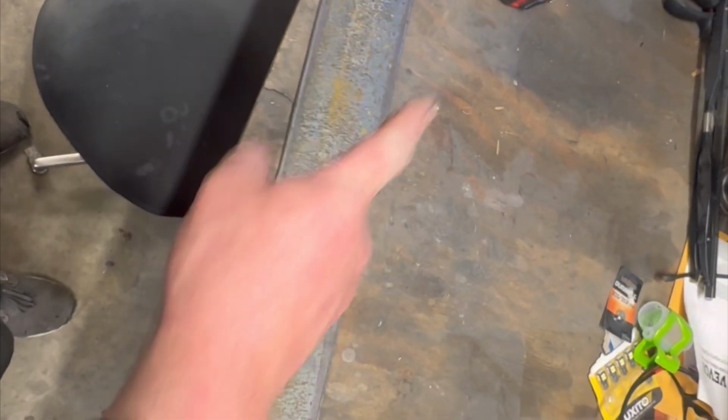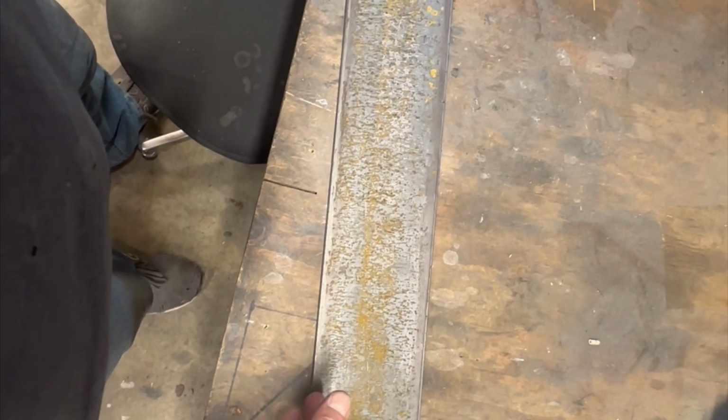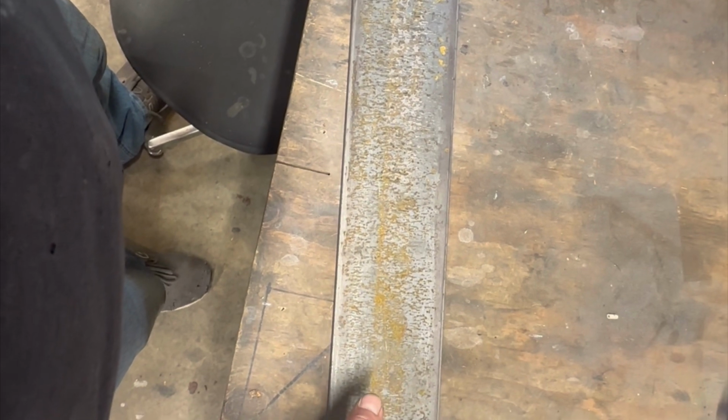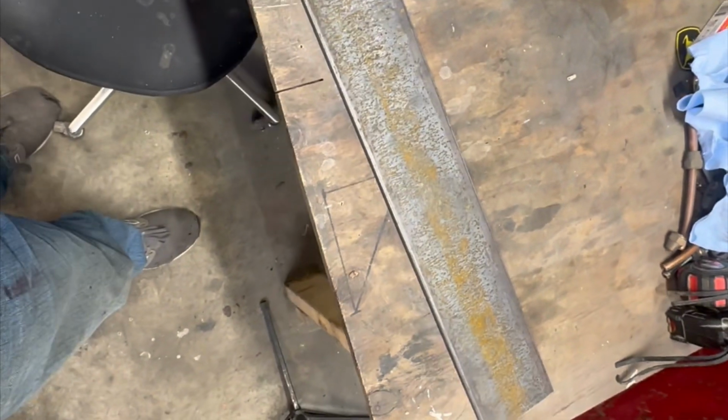All right, guys, well, it doesn't get much easier. I've taken some measurements, and we've got a flat frame. Exactly 8 3/4 inches over is the center of the rear cab mount. And we can float this thing wherever we want for height. It goes right between a couple bolts, so we don't have to worry about clearing anything, I think.